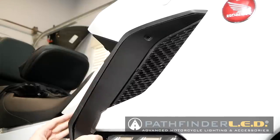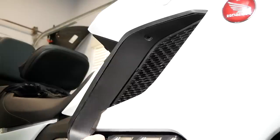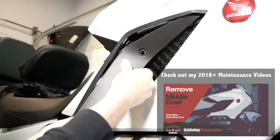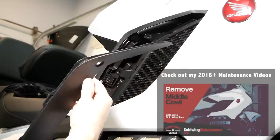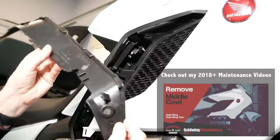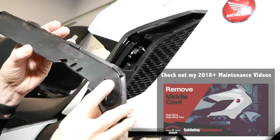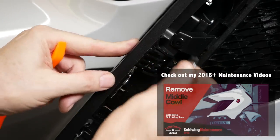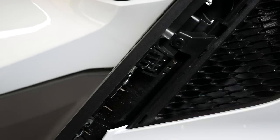If you just pull on this black plastic, it's rather flimsy and malleable. You can sort of remove these clips. You'll hear some noise when you're doing it. Don't be concerned. That's just normal. You can see the clips here. Now, you're going to do this on both sides of the bike. And once you're finished, you also want to release this body clip from the shelter.